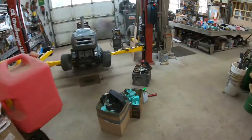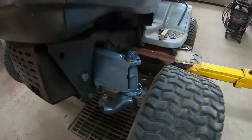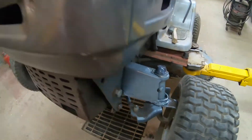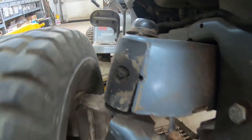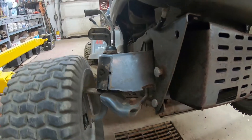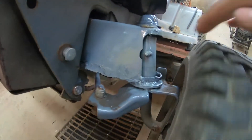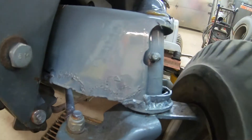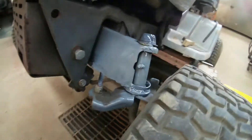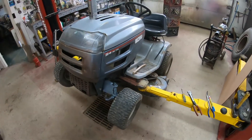I've also got my mother's lawnmower in here doing some repairs. One of the spindles on this thing started out life with these plastic, cheesy fittings — this thing is garbage. She hit something with it and totally ripped off the front wheel. So I used a piece of three-quarter inch water pipe, welded it all together and made it work, and stuck a grease fitting on there so at least now that won't fall off.